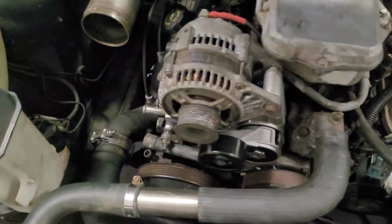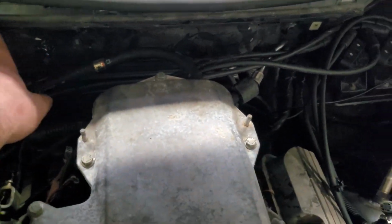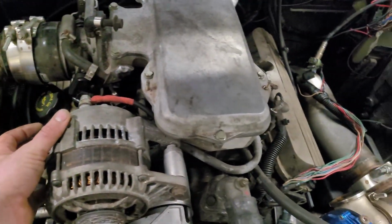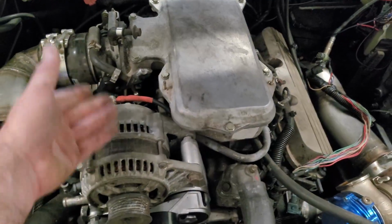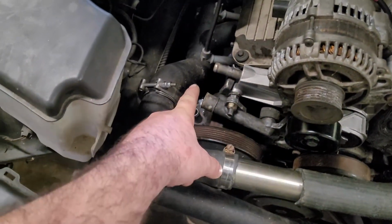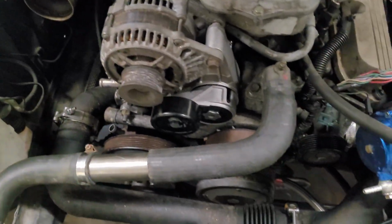That's also a problem for future me. Get the power steering reservoir mounted. I'll mount the map sensor. I did go and fit this rear scuttle panel back in the car. I found and fitted that. I've got to try and sort something out with the alternator. I think I'll just loop the excite wire back over to here on the post, and that should give it charge. But I can't start and run the car with the alternator belt or drive belt on it until I sort the power steering out, so then it's not running that pump dry.